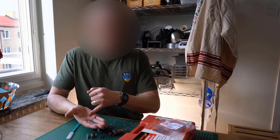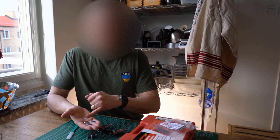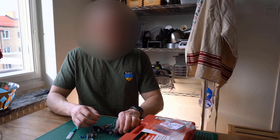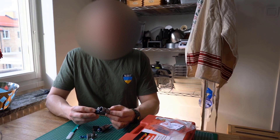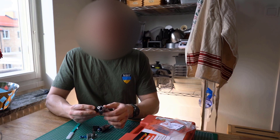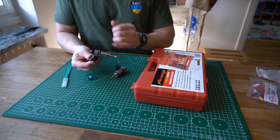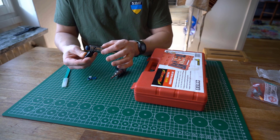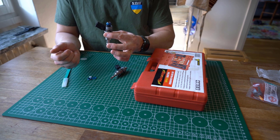The o-ring tends to stay in the intake manifold, so make sure you remove those. The kit also contains the Teflon seal. I'm only going to replace the Teflon seal, this blue gasket, and the o-ring — I'm not going to touch the basket. My baskets are fine and my injectors are pretty much in new condition. So to summarize, once assembled we have: the o-ring, blue plastic gasket, the basket, and then the Teflon seal.